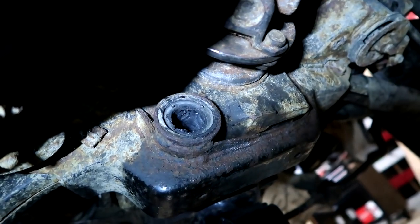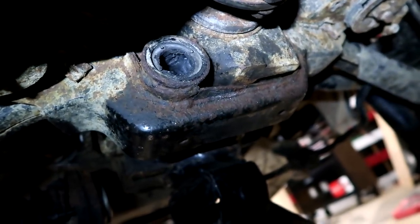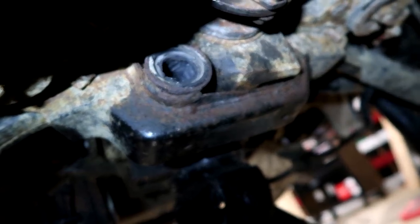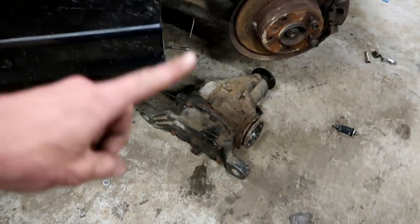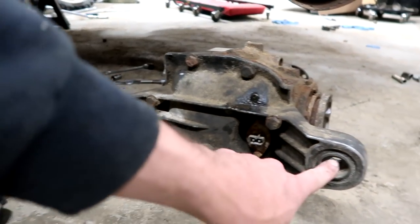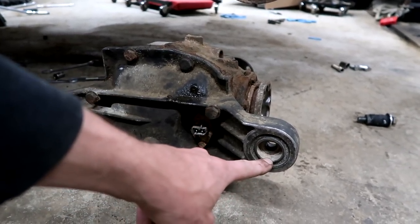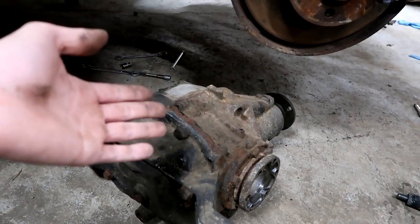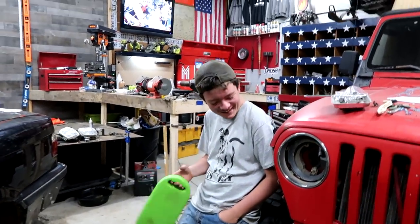That's where our bolt was, and you can see it's clearly missing a whole bunch of rubber. So I'm going to tear this differential out and order the neoprene bushings — they're a little harder to ride but they're stronger. I replaced the back two when I took it out the first or second time, and this thing has three of them. Danny, you ready to rip this thing out? Hell yeah. The diff is out for the second time in one day. I've come up with a plan: replace these rubber ones — they only probably have two hours on them — with the heavy-duty neoprene ones. I'm also going to do a fluid change and push more toward preventative maintenance so we're not pushing this thing in and out as often.